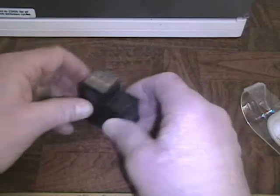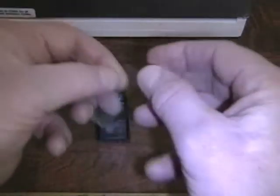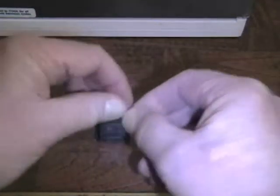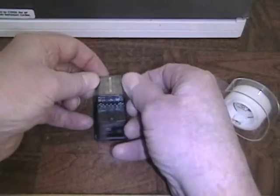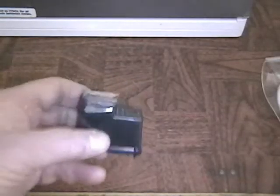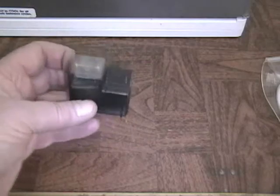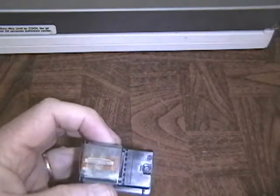Just a little protection to keep it from drying out. Some people recommend putting a second piece over crosswise, just making some little folds so it will be easier to get off when the time comes. No sticky surface is touching the print head. That is prepared now to go into long-term storage. The print head is covered against evaporation, hopefully. It looks like maybe a little ink contacted the dry side of the tape, but not much.